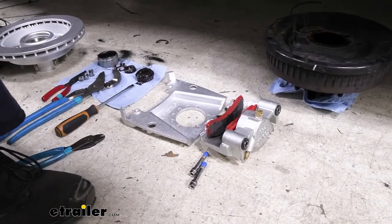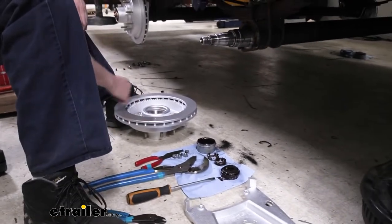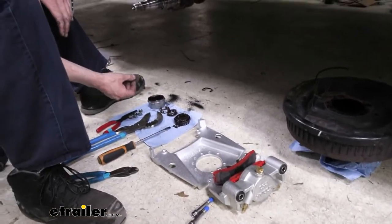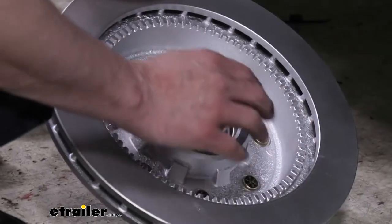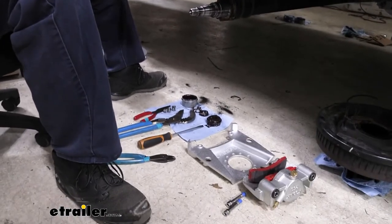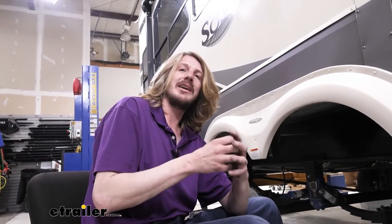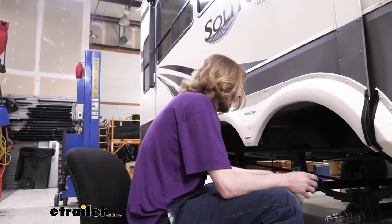Here are the parts that come in your disc brake conversion kit: your caliper, bracket, and new disc brake rotor. Our rotor - we'll come back to that in a minute as we'll be putting bearings in there. You can potentially reuse your old bearings, although I highly recommend replacing them. The new rotor has races pre-installed inside. If you pull a bearing out and put it into a new race, it potentially may not wear correctly in that new race and you can get premature failure. So use two new parts, let them match to one another, and you should be good to go.